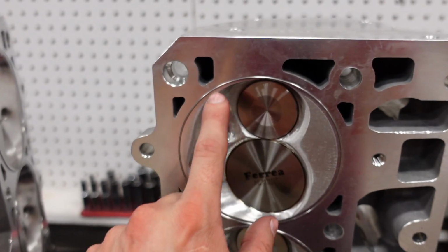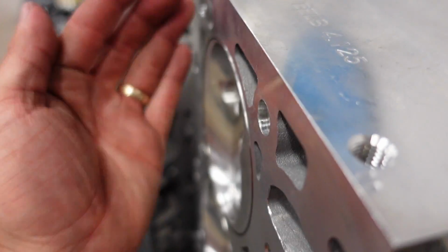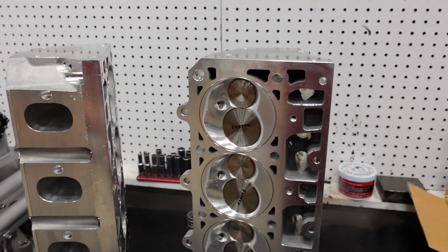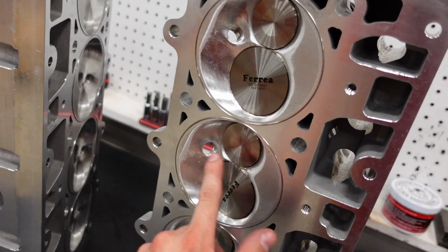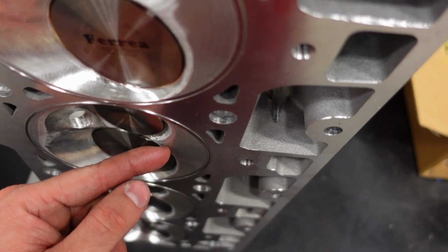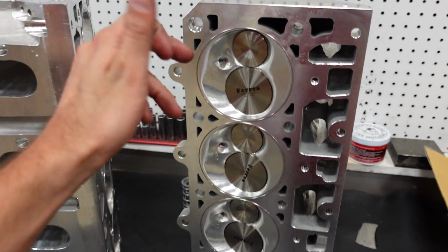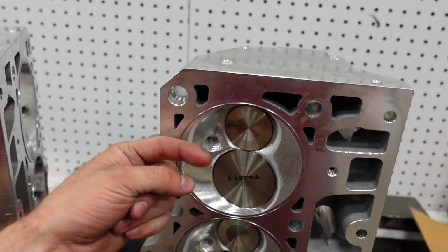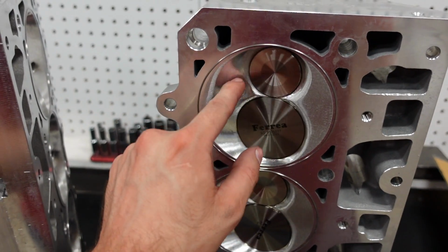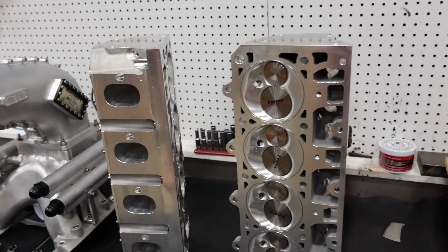And now you can see that top fuel hoop that is cut and recessed into the cylinder head. So that hoop will crush the copper into the groove of the block to fully seal everything up. They have softened chambers, which basically means there is a very small 3 or 5 degree cut that's performed from the edge of the bore leading into the chamber to help slow down the flame front. And that's also why the spark plug is actually tweaked a little bit closer to the exhaust valve and out of the center of the cylinder, so that we start the burn somewhere over in this neighborhood, and then it can slowly travel across the combustion chamber.